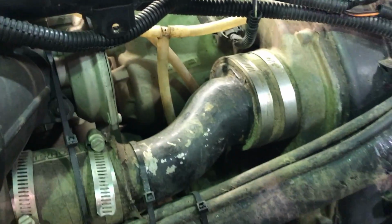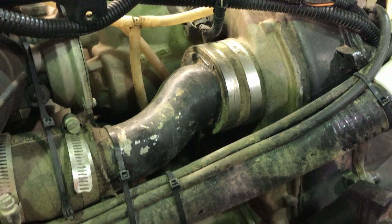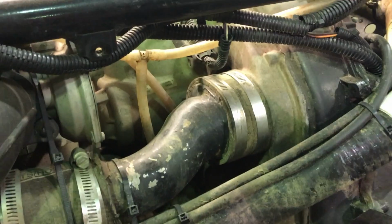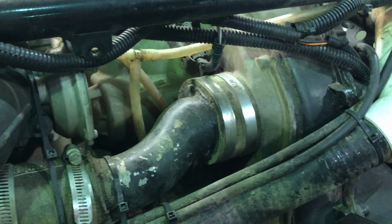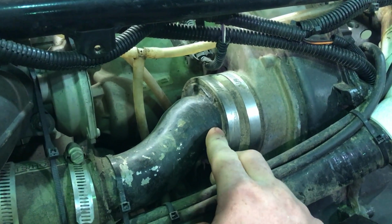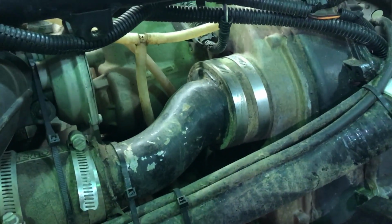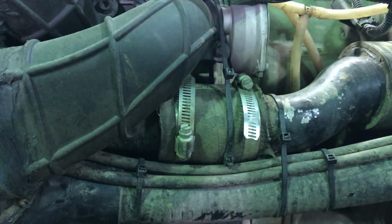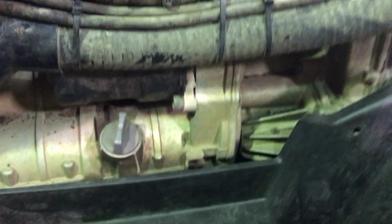And then down here they also had an epic fail. That did not seal at all how they wanted me to do it. I had all kinds of issues, so finally I decided just to build this. This is a piece of 3-inch pipe matching the exact oval of the inlet, and then it's adapted down to 2 1/4 exhaust pipe and a couple pieces in here to make it fit nice. All welded and sealed up nice. And then a chunk of big truck rad hose has a coupling, and all of that sits really nice.